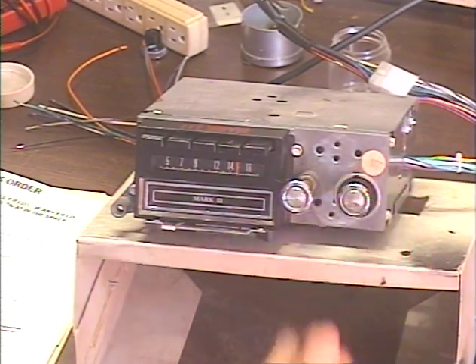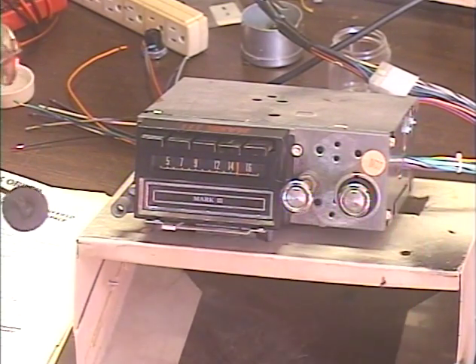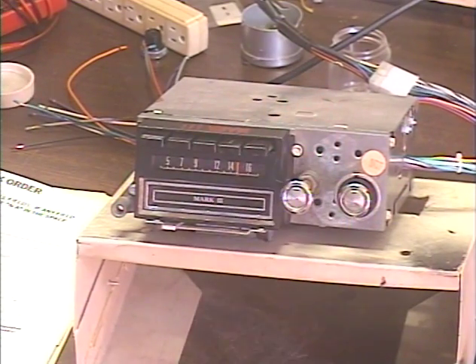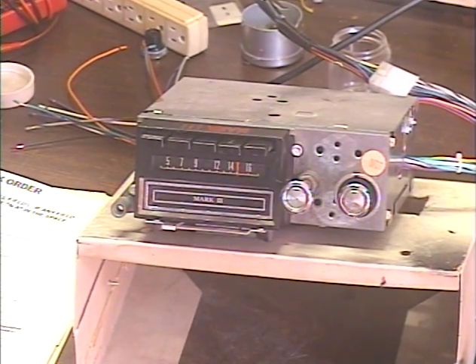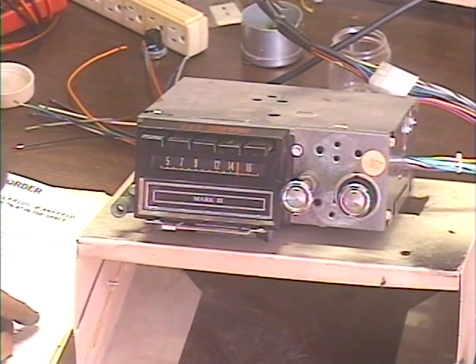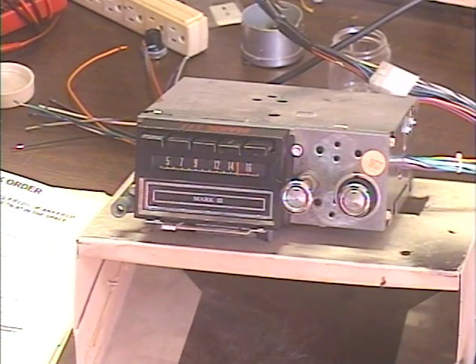So we have an AM-FM radio instead of just an AM radio. Now we've got the FM stereo light, got the 8-track working, got virtual balance and fade. The original fader — I never reuse the original fader because most of them go bad after a time. I've had one today that did not send power to the left rear speaker. They're self-destructed by design, so I never reuse the fader.